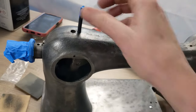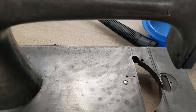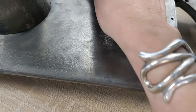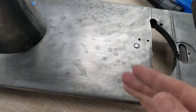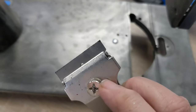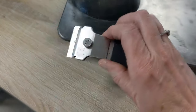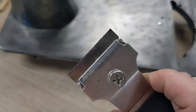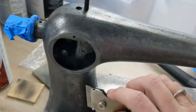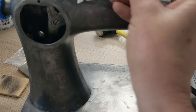I am working on getting her masked up here. I wanted to point out something I don't think I have before — these little scrapers with a razor blade are fabulous at this stage because they can pick up things that I might miss running my hand over it, or that my eye can miss — just getting extra little pieces of paint off. The thing is, it won't show up much right now but as soon as you put primer on it, it shows up a lot. Getting that off at this point is just going to save me time and make it look better later.